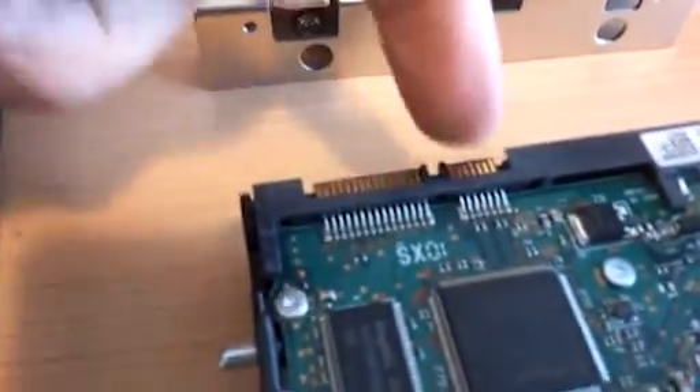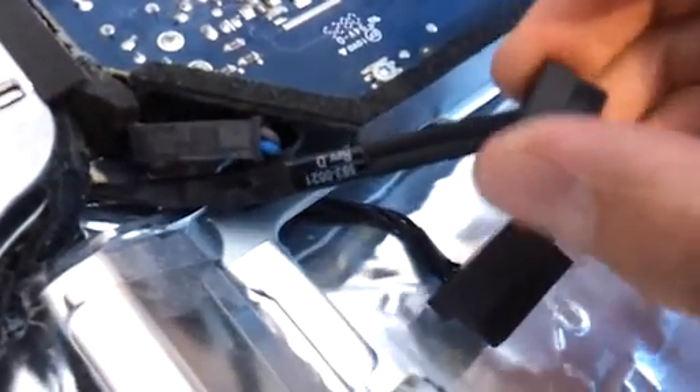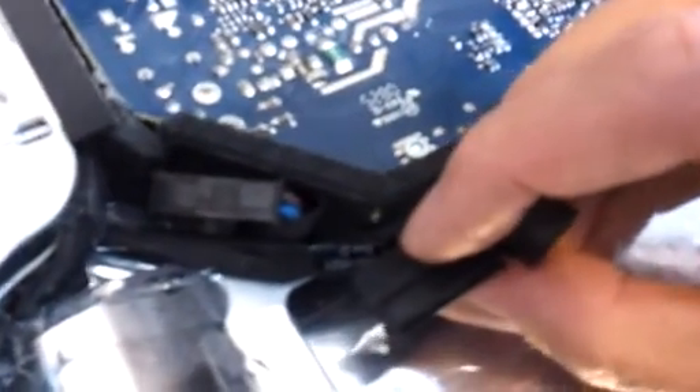Namely, when you get to the stage in his videos of taking out the old hard drive, these are the two connectors which come off the two connectors on the old hard drive. Apple, in their infinite wisdom, have made the data SATA cable too short, and they've made it so that it literally sits in the correct position for a 3.5 inch drive.